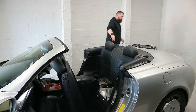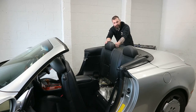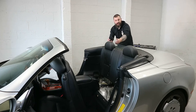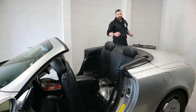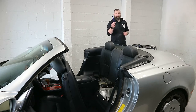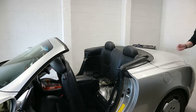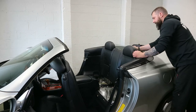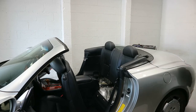The next thing is the covers on the back of the rear headrest. Just grab it from the side where the plexiglass is — you'll be able to get in there and just give it a wee pull out. If you can't pull it out by hand, you can use trim removal tools. But as you've just seen, it comes out relatively easy.